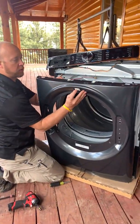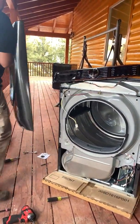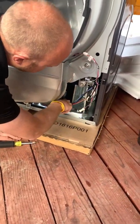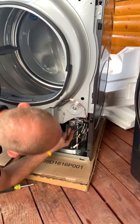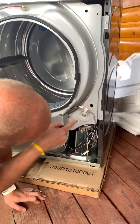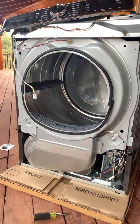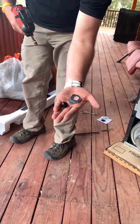It lifts off, then you have the door closed switch that has a pin — it just depresses and pulls right off. From here you can get into the gas burner assembly. When I did the last one I took these two bottom screws off and tried to pull the whole thing out, but the wires are all in it — really hard to get out. So right now I'm going to try to take just the ones that hold the gas valve to the bracket off. You will probably have to undo the screw in the back that holds the gas line in place.